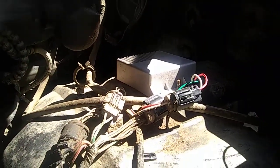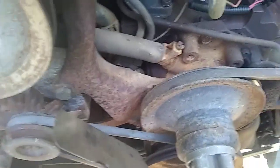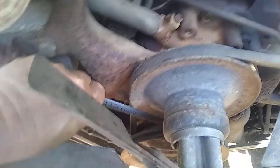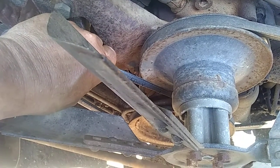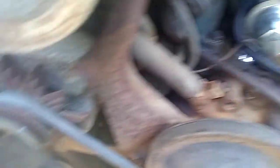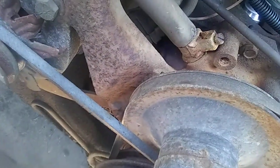I wondered about that — that's why I ordered both of them. I've got the radiator out too, and I've got a small leak in it, so I'm going to take it to the radiator shop and have them fix it. I'm going to replace these hoses right here, or these fan belts — power steering, alternator, and water pump belt. So I'm going to replace both of them.